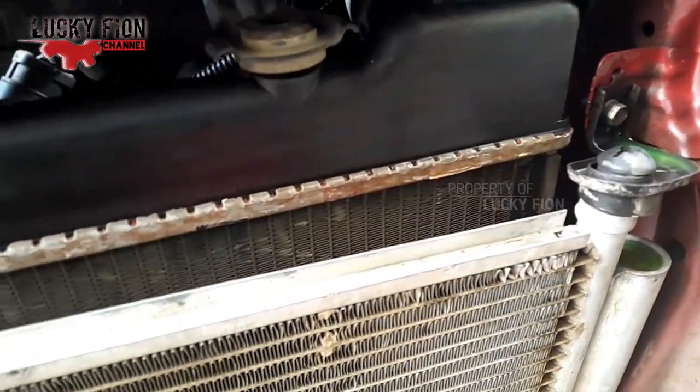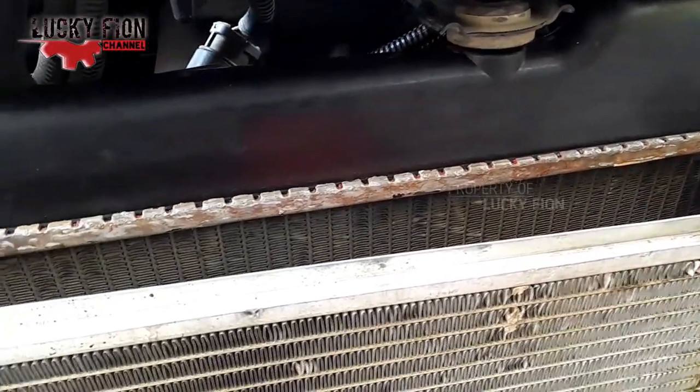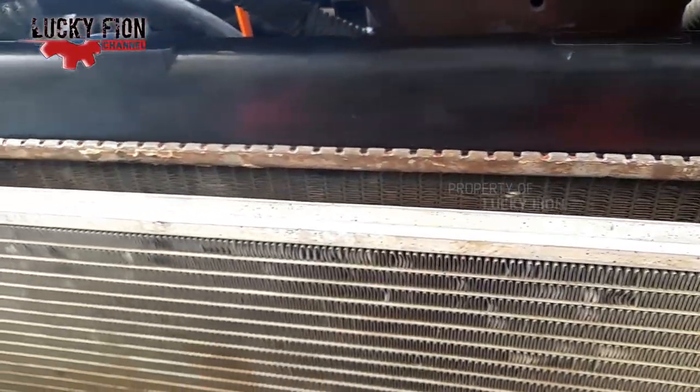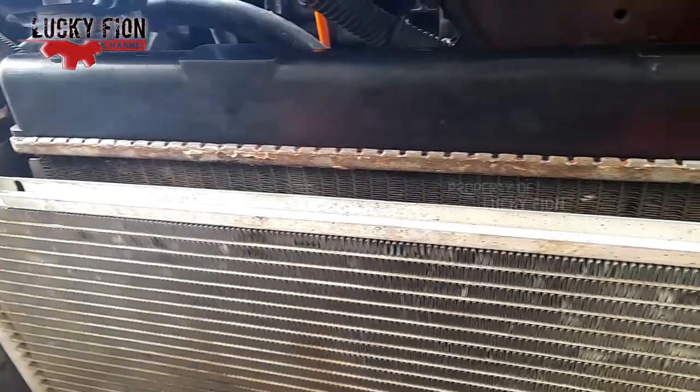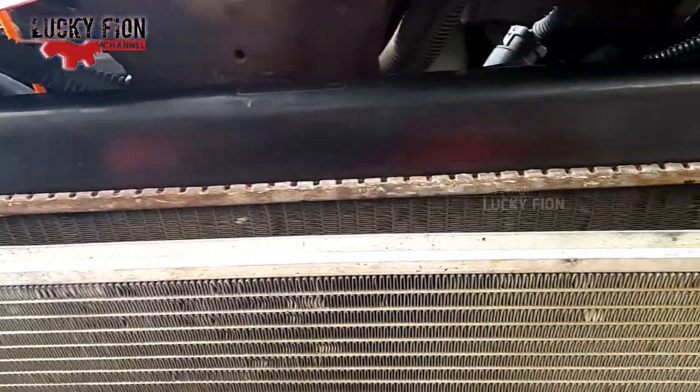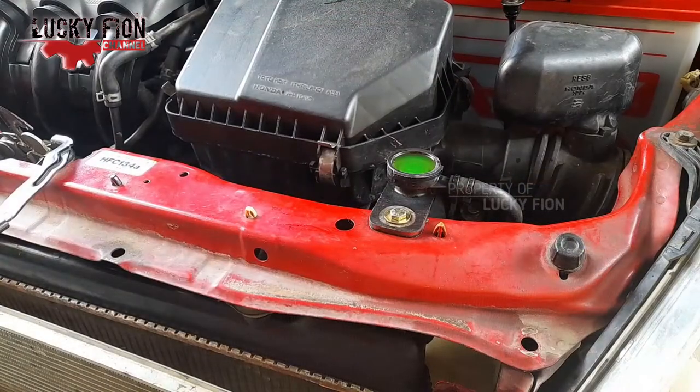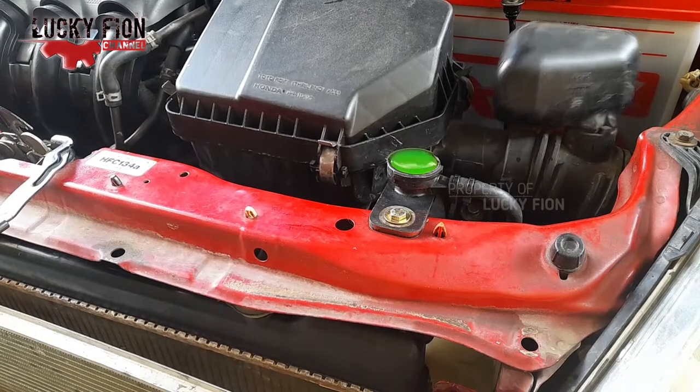While we see if there is a leak in the newly replaced upper tank. Well, if the radiator is not releasing air anymore, buddy, you can finish the bleeding coolant process and turn off the engine, then close the radiator as before.